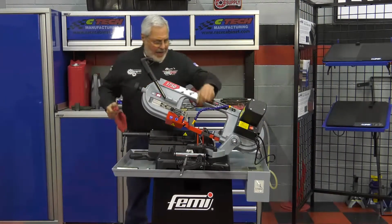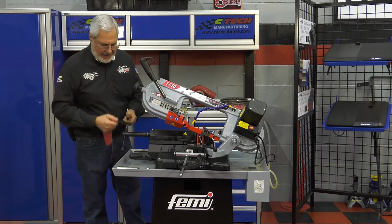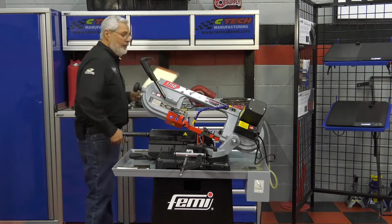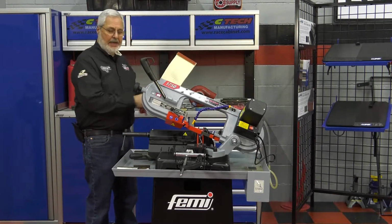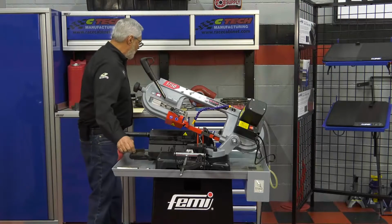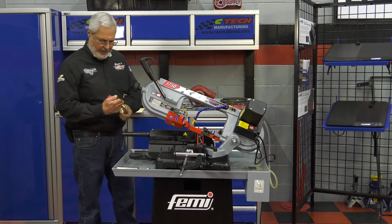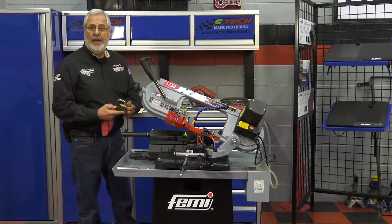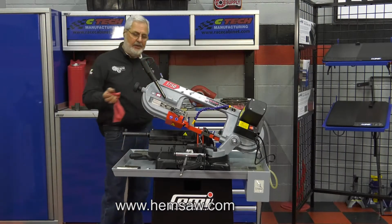All right, caught me doing a little fabricating here. I'm building some pieces of angle iron. On my trailer, I'm going to put some D-rings. I drew a little diagram and I figured it out. I want to reinforce the bottom of the D-ring bracket. Where I go through the floor, I'll have some angle iron to back that up a little bit. That's just for tying things down, not cars.